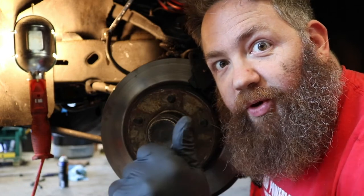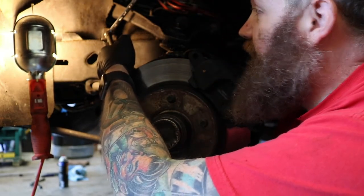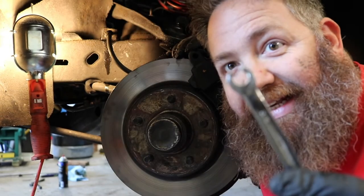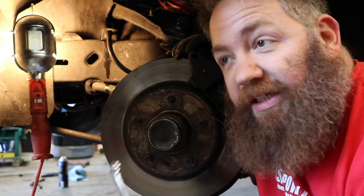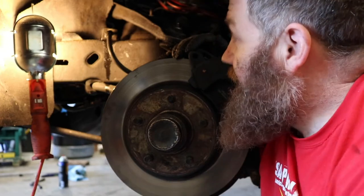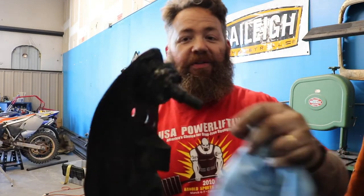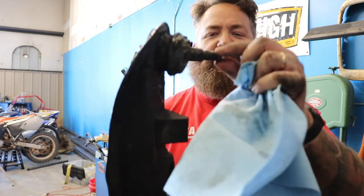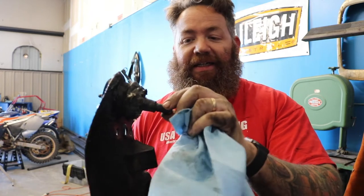Real quick — very important: I'm taking this brake line off. It's been on here since 1972. Now those are brass fittings and they're tapered. If you go to take one of those off, use a line wrench — see the little cut in it so you get bite on most sides. Do that, because if you round it off you have to cut it off, make a new one with a double flare tool, and that sucks. I've never seen a ball joint completely eat it like this — the dust cover's blown out and it moves way too easily. You shouldn't be able to spin it.